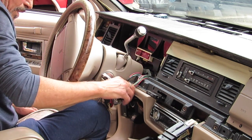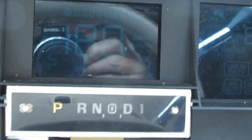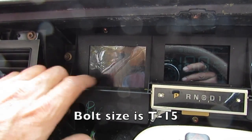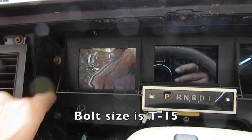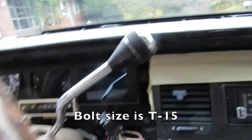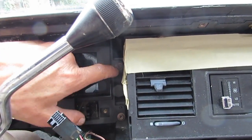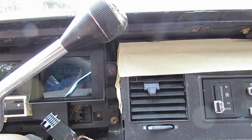While you're under here, take a real good look at these wires and make sure there are no burnt or broken ones. Just look for something abnormal — you might be able to get away with just fixing the wire or replacing the connector and get lucky. Turn the key, put the car back into park, tilt the steering wheel down, and you're going to find the four Torx bolts at the corners of the cluster. Just those four bolts, nothing else — that will loosen up the cluster so you can take it out in one piece.